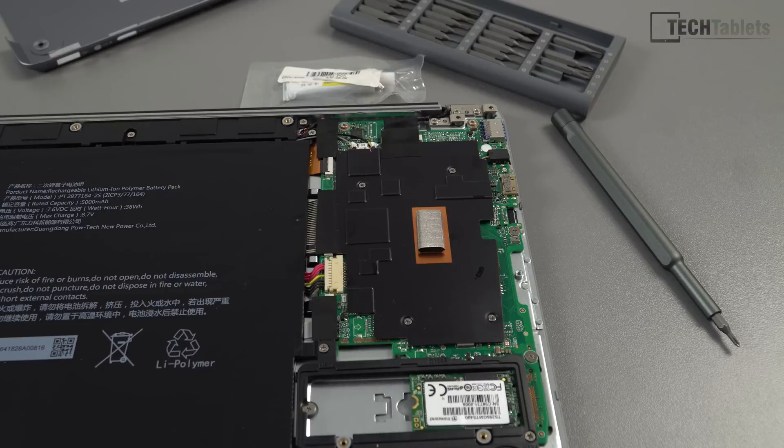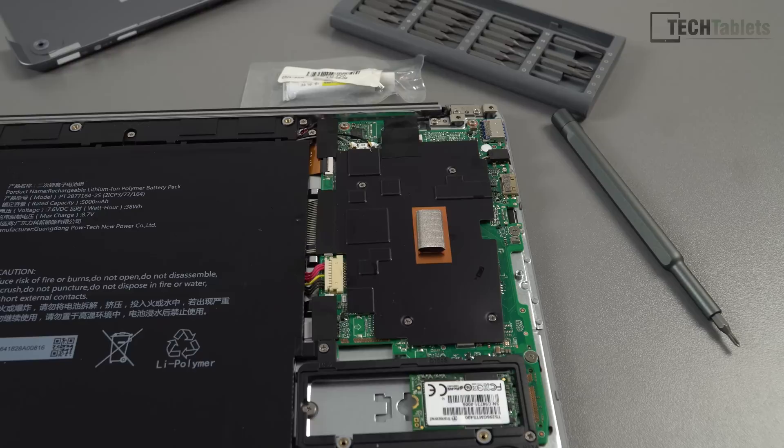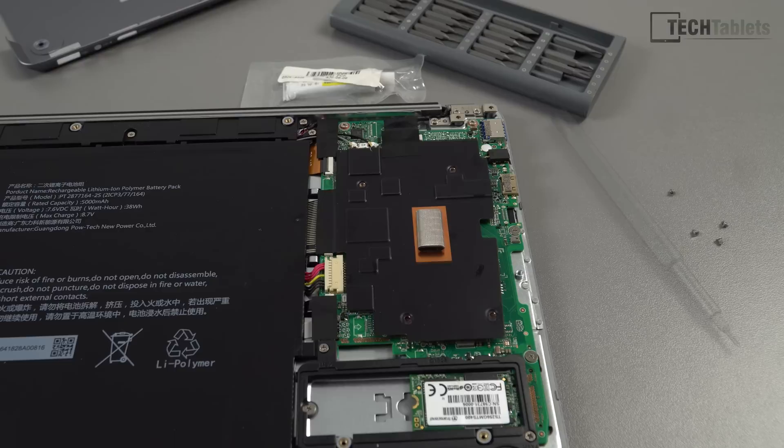They used a thermal pad, which is fine, but my thermals got up to above 85 degrees, so it's getting a little on the hot side. If you want to tweak the power limits or want maximum performance, it's advisable to do this mod. You can also get away without doing anything if you're doing light use and performance is fine. If you're not comfortable opening up a laptop, please don't do this mod — you do this at your own risk.